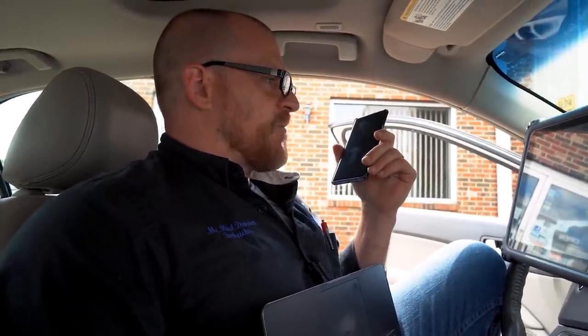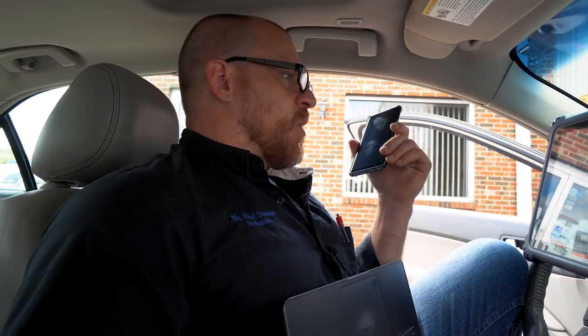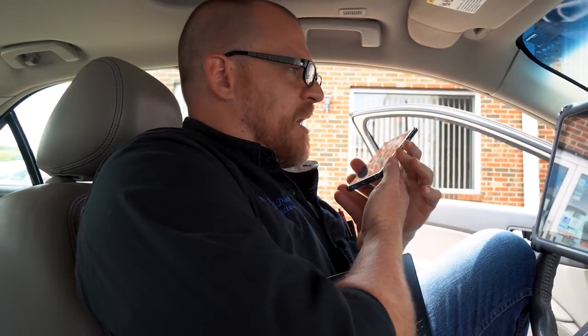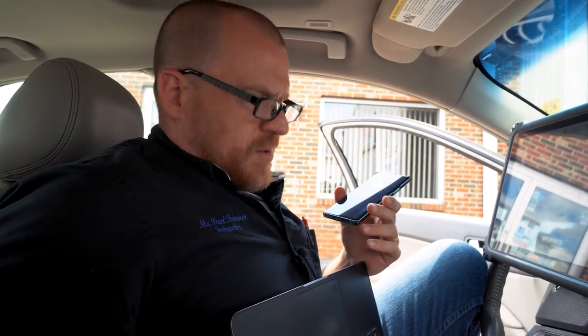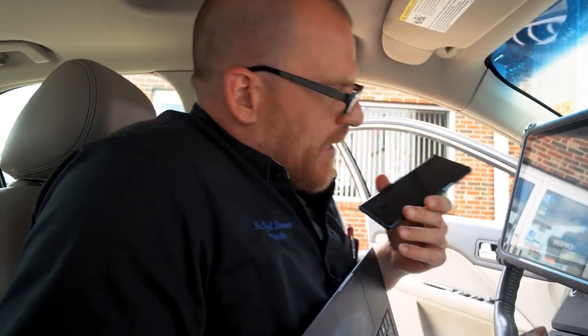But you saw 80 on the EVAP temperature from what you remember, and it wasn't coming on. That makes me nervous then. That makes me nervous. But still, what I'm seeing right now, there's no question about it. This is an EVAP temp sensor that's causing our issue. Yeah, that would make perfect sense. That's what I was hoping to see. Yeah, so now the question is how do I get to it and all that?